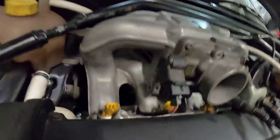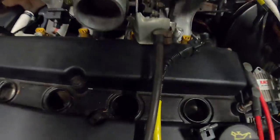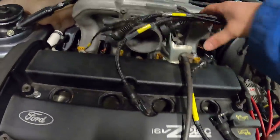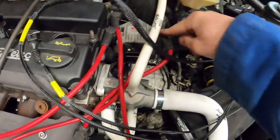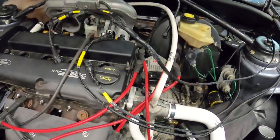I've changed the throttle position sensor plug to suit Jamie's TPS, and changed all four injector plugs to the Subaru-style connector. Now laying the loom out nicely, tucking it under the back, and plugging it all onto the injectors. Jamie's fitted the coil and run the ground for the coil off to one side, and the other ground for the ECU is at the back — this is the VW coil pack, although it has KMS written on it they are exactly the same.